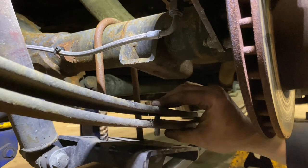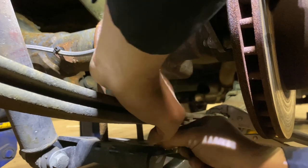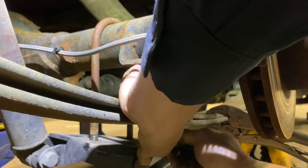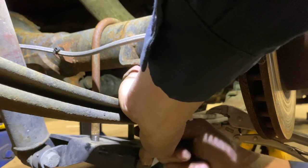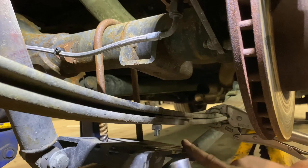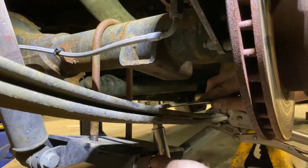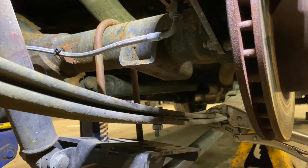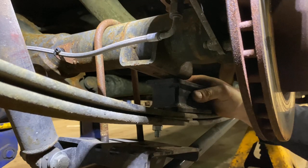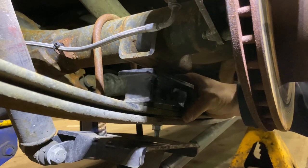The spacer between the two should go all the way through. Take the vice grips and clamp the springs back together. I know this is the right bolt — there we go. Now I do have the appropriate size socket so we're not putting vice grips on it again. Helper spring has been removed — now I'm going to reinstall the block. You can go up with the jack a little bit.